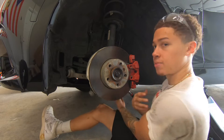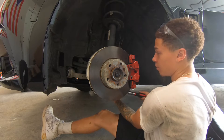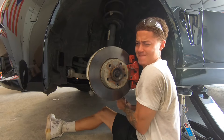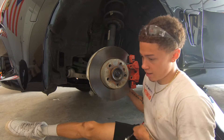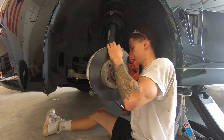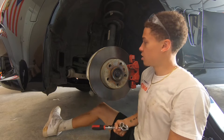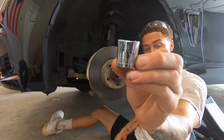I'm a smaller guy, so I literally use this wheel well as back support so that as I'm cranking down, it gives me a lot more force. There's the bottom one — I'll unscrew it the rest of the way by hand. Now for the top one, it's gonna be a weird angle, so I suggest trying to get it from the top. I'm trying to do this with a deep well socket because the bolts were so tough to get off that they actually cracked my regular socket.